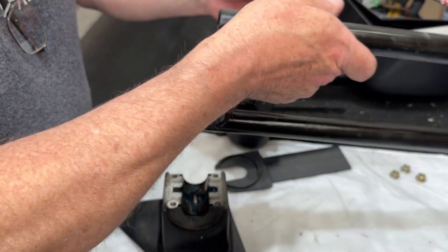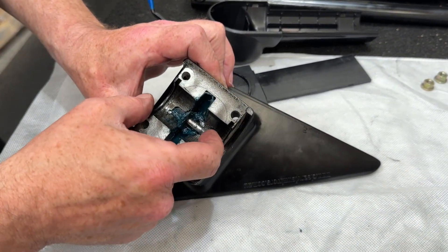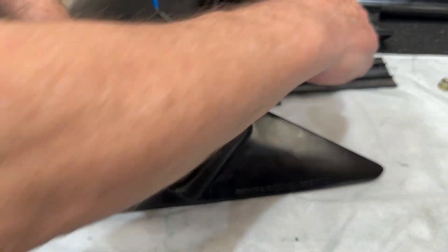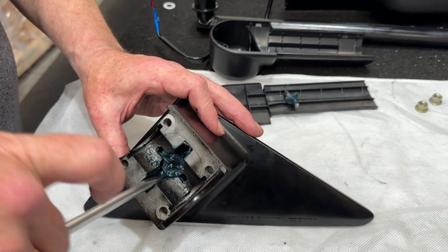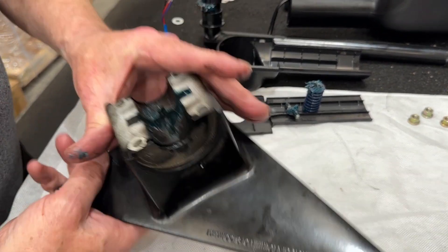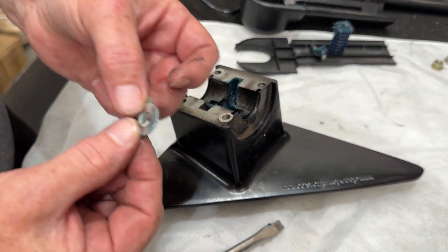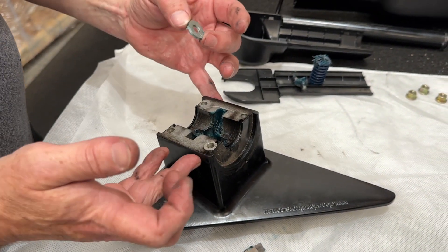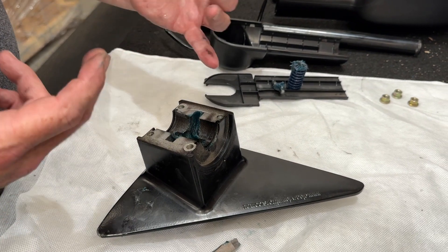Your arm with the cam. You'll notice here we've got a pin — yes, there's a lot of grease there, and there needs to be. Don't be overly concerned about that. Set that aside. You've got a spring in there that needs to come out. And you'll have two washers underneath. These washers increase the tension behind the spring. Don't lose them — you're potentially going to need them in your new base. If you've just gotten a replacement base, it may not have these pieces in there.